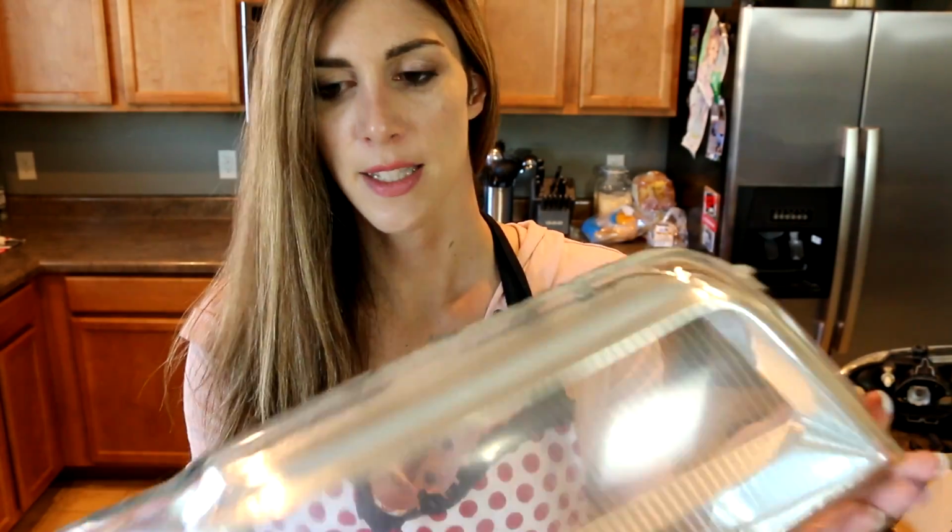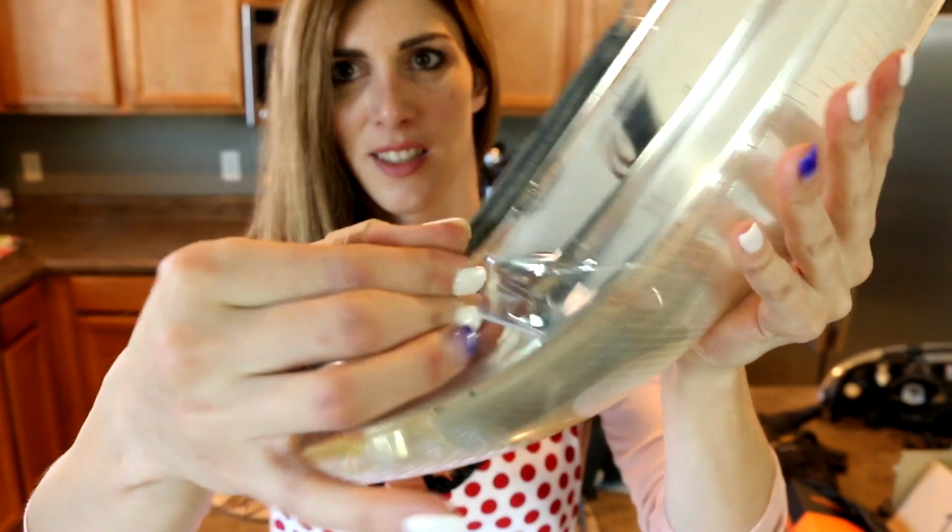All right, this took an hour to pull apart. So what did I learn with this? Because this is a 19-year-old headlight, usually I do this at 170 degrees Fahrenheit, and that works for newer headlights. This headlight, I have it on 240. So I did 240 for 10 minutes because this glue, look, it's still like kind of hard. But because this is so old, it didn't let me do that. On a newer car, you won't really run into that because they come apart a lot easier.